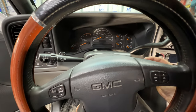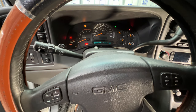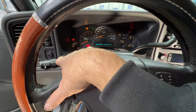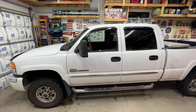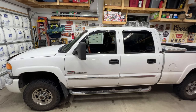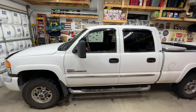Let's just double check with everything back together — there's our right signal, and that looks good. Left signal — looks good too. So that worked. This was a 2004 GMC Sierra 2500 HD; went ahead and replaced the flasher relay and that seemed to take care of our turn signal issue. Hopefully this video helps you out — really easy job to do. If you haven't already, subscribe to my channel, check out all my other videos. I've got a bunch on this truck alone — I'll see you next time, thanks for watching.